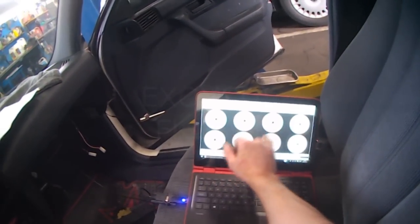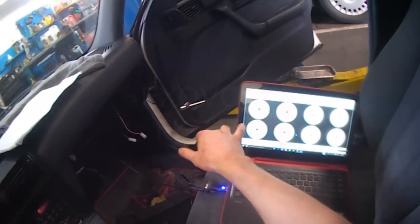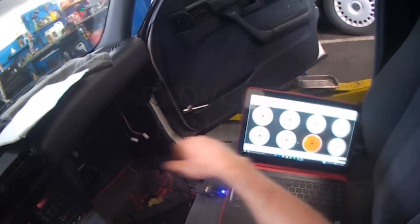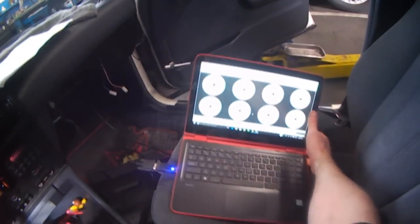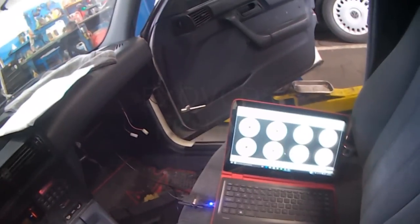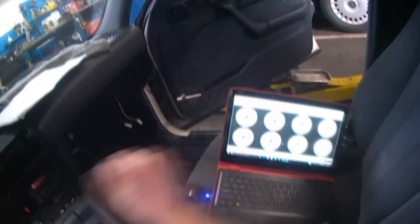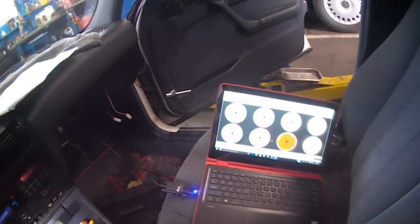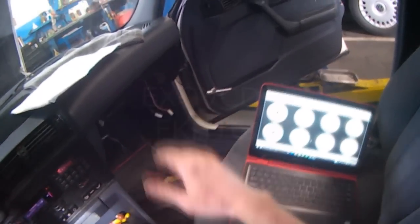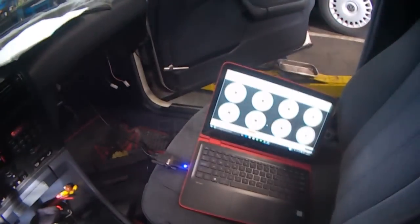Coolant temperature is okay. Engine speed, obviously once it's running it does show, and then ignition timing changes, and it obviously came with a base map, so it should have run right out of the box. But what I had noticed was that the map sensor, there was never a signal, no matter what throttle position. And like I said, it was running boom, boom, boom. So then I tested the map sensor, and it's lucky that I sort of have some understanding of what's going on.